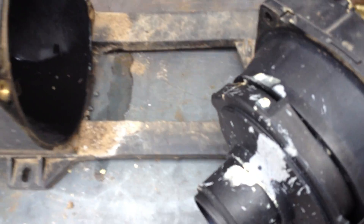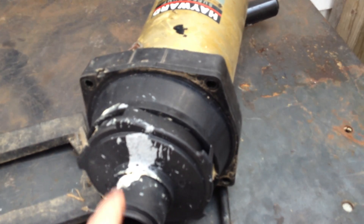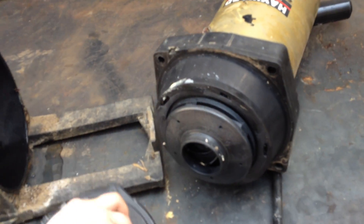The last thing I'm going to show you — I'm going to push this back on the bench. Now you can see that this motor and pump is separated just like that. What I want you to do now is show them — pull this diffuser off, just go ahead and pull that right off. That diffuser pulls right off, just like that. When you go to put it back together, you can see right here it says 'top.' It says top there, and also on here it says top as well.